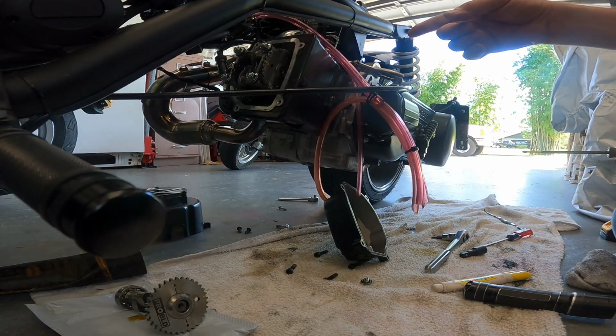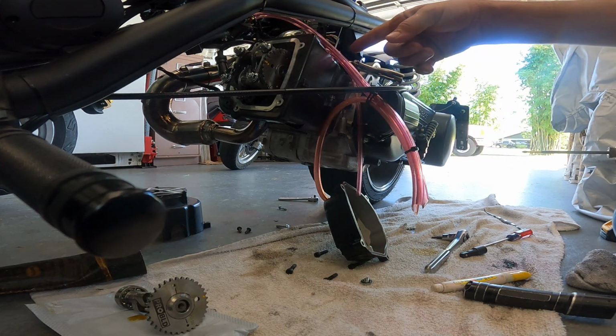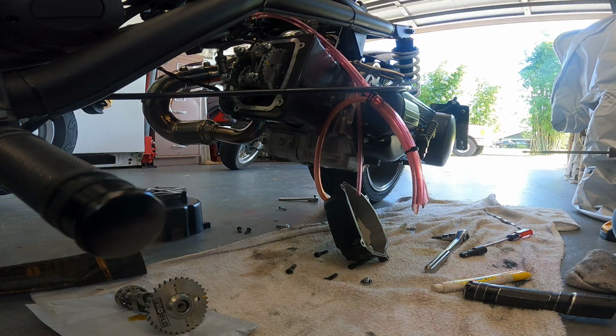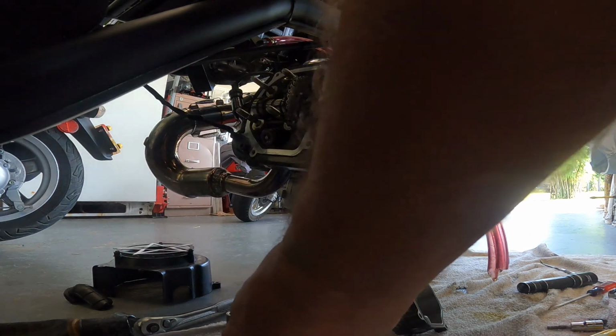Okay, top dead center on the crank, top dead center exhaust on top. Got the cam chain marked, got the tensioner held. I think we're ready to swap these cams. Lift this rocker box off. Right, so the exhaust side is marked E.